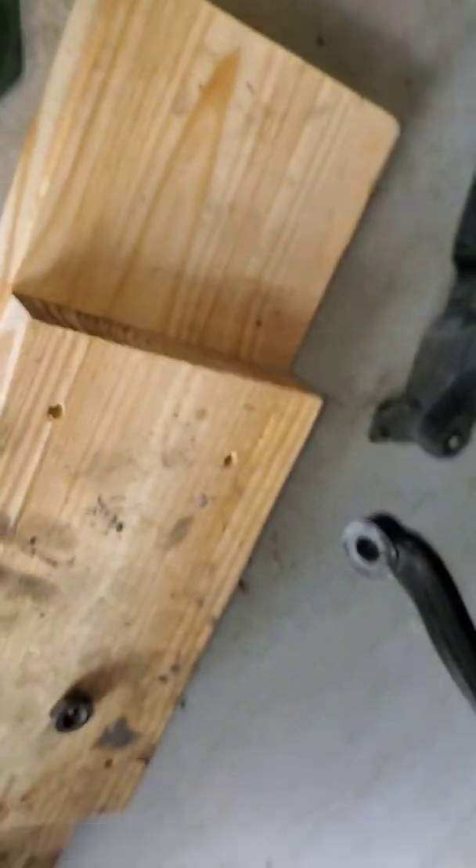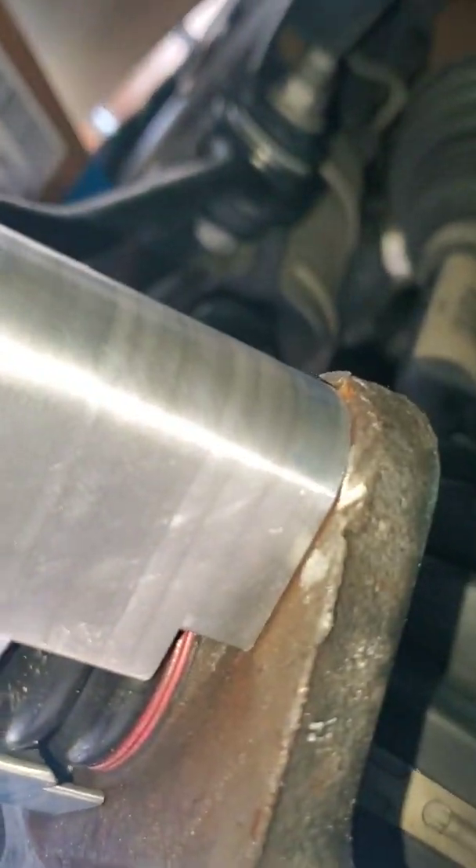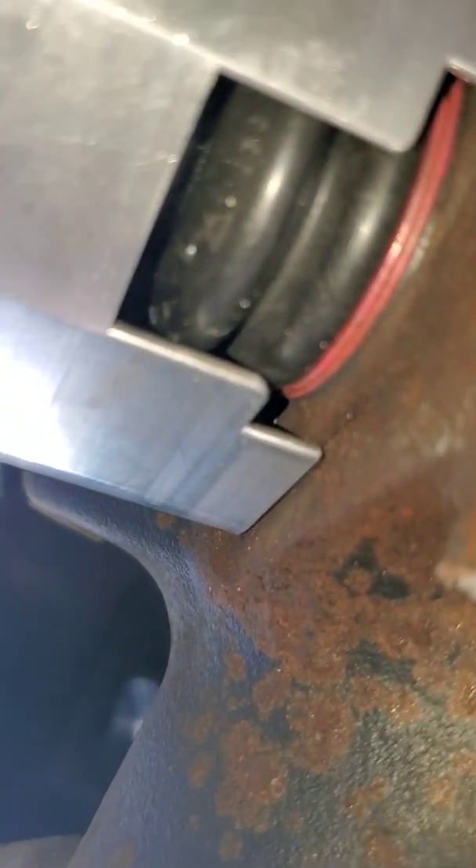If we go ahead and grab the ball joint adapter — this is what it looks like, it's a custom piece that I just made — it just fits right over the ball joint like this. When you're pushing it in there, make sure that the ball joint threads are poking past the bottom hole opening here. Also make sure that the edge of this adapter sits all around the ball joint — it should not be sitting on the ball joint, it should be sitting around the ball joint.